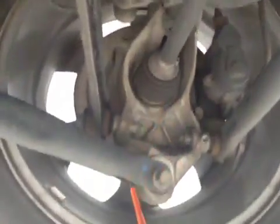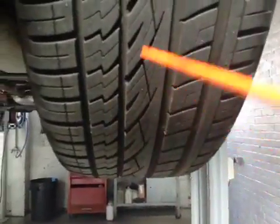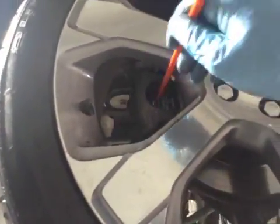And the driver side rear suspension all looking good. This is the driver's rear tyre — tyre is green on the health check, no signs of foreign objects inside the tyre tread. Rear disc is in okay condition and your rear brake pads are on 7mm, so the pads are green, disc green, tyre is green.